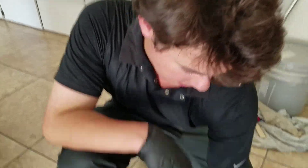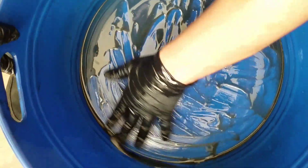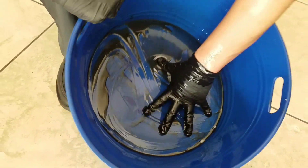We dumped out all the gear oil from the manual trans, and there are no chips — absolutely no chips. But there is a little bit of powder in there. I think it's going to shift a lot better with that powder out. If you sent the oil out for analysis, I would assume it would come back with a pretty good metallic count of very fine particles. Those are all going to be out of that manual trans, and it should shift a whole lot better.